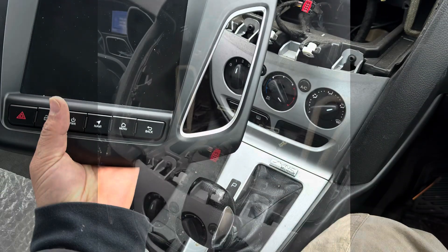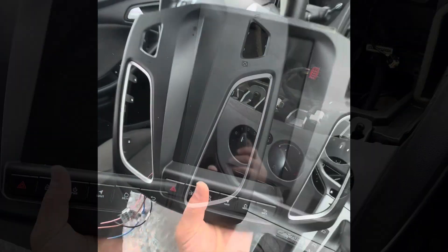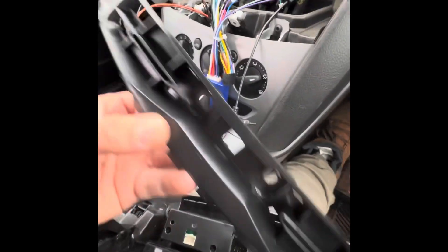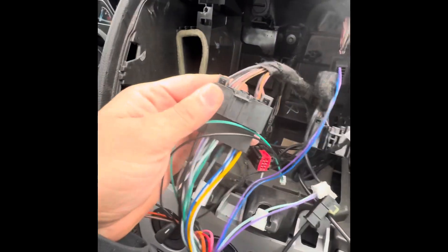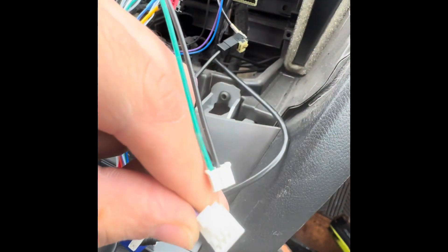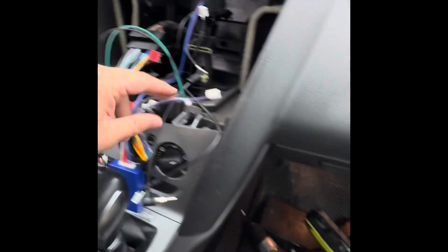This is how to remove the radio. Please subscribe to my channel. You have to remove this — it goes in here, you have to remove it because this frame doesn't fit. So now it's okay. I plug it — this is the main wire, and this is the harness. This wire you have to plug in the back of the audio; it's for the wheel control button — if you don't plug this, your wheel control button will not work.